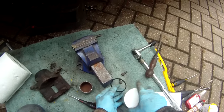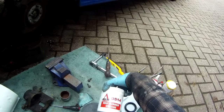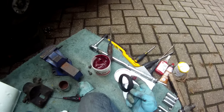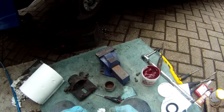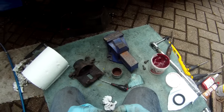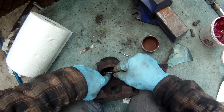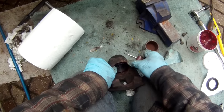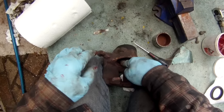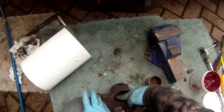So now we're going to reassemble everything. We need to use this rubber grease. One of the secrets to rebuilding calipers, keeping them rust free and smooth operating, is rubber grease — this is red rubber grease from eBay and it's basically used to lubricate all the rubbers and pack the inside of that weather seal. It keeps the elements out, keeps the rust at bay, stops the water getting in, and lubricates everything and looks after the rubber. I'm actually going to use this around the seal as well — probably something they don't do in the factory but especially important if we're reusing the seal. Push that back in and make sure it's flat all the way around.